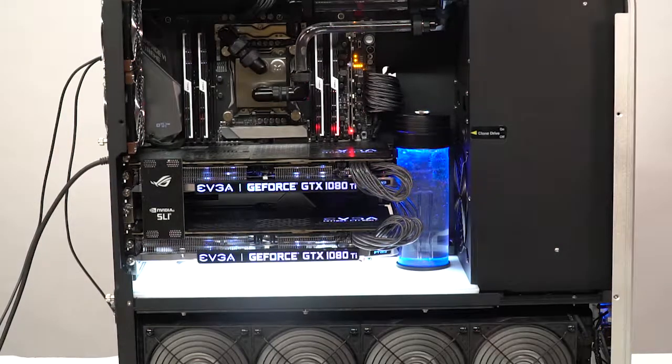That's about it. She's booted up. I'm going to shut it down. It's a very quiet running machine. All of your fans are currently running at about 50%, and that's all you need. If you really put this thing through its paces and you're doing some serious composite work, or stacking a couple hundred images, and this thing starts to really kick in, at that point you'll hear the fans ramp up. They will automatically increase. The pump will automatically increase. Everything is designed so that when the system reaches 60 degrees, everything starts kicking in and it wants to cool itself way down. And that's about it. I'm going to shut it down now, and that's the end of that. Everything else is in your manual, by the way.